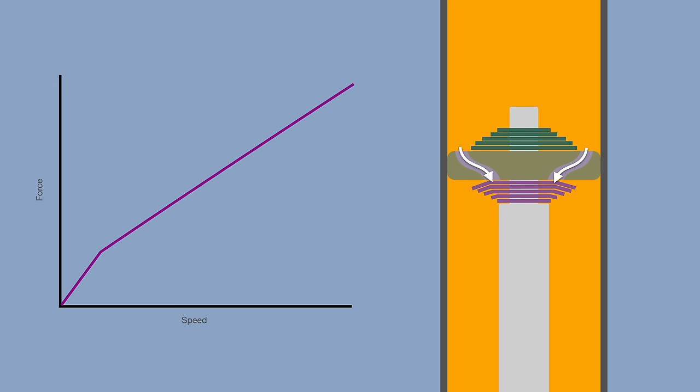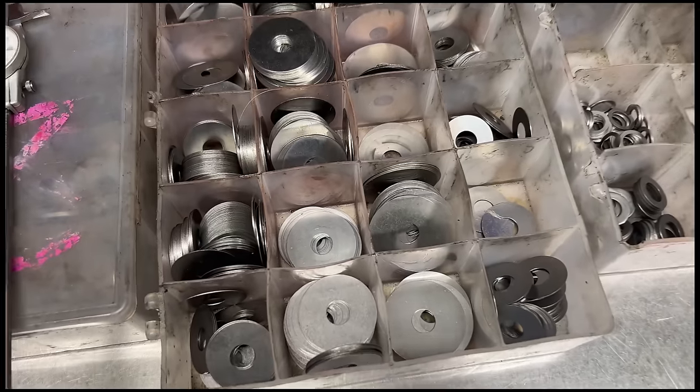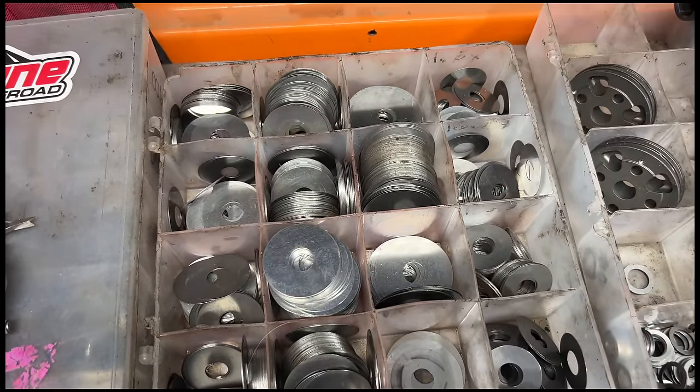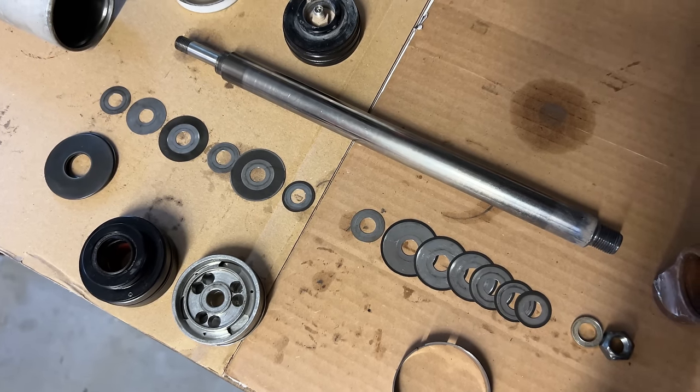The shims are usually stacked largest to smallest. This just helps prevent the shims from all deforming after a bunch of cycles. Think of it as a leaf spring rotated around a circle. Note that you can't replace two shims that are 10/1000ths of an inch thick with one that's 20/1000ths. The stiffness is proportional to the thickness cubed, so a 20/1000ths shim will be 8 times as stiff as a 10/1000ths shim. Changing the different shims will do different things to the curve.